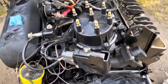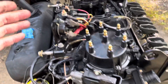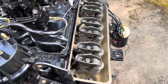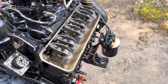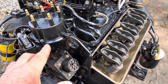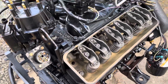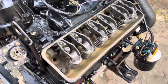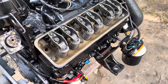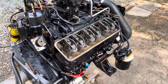So that's an alternative method for timing a distributor — you don't have to go off one, you can go off four as another way to do it. So just thought I'd do a quick video, show you how that's done. Now that it's installed and I've got it locked down, it'll crank up on this position. It may not be perfectly timed, but that's called static time and that's good enough to get it running. So about to put the valve cover back on and put the exhaust on this engine and this thing's going in the boat. Thanks for watching and subscribe if you enjoy my videos.